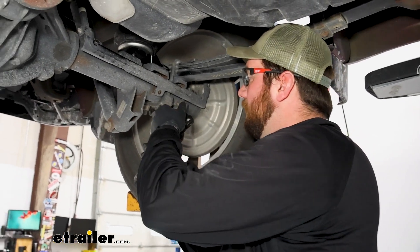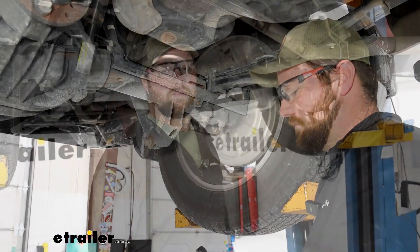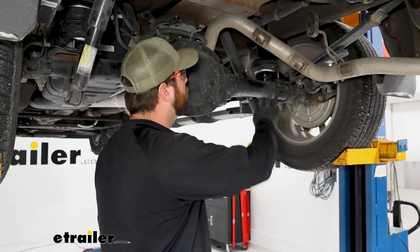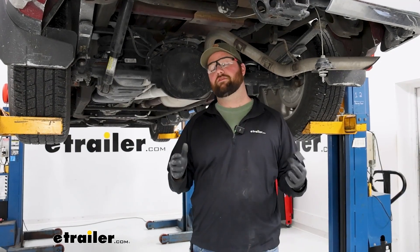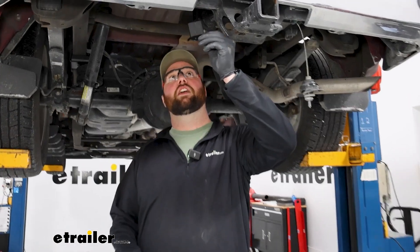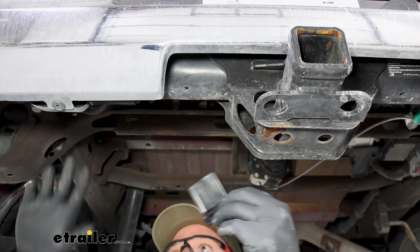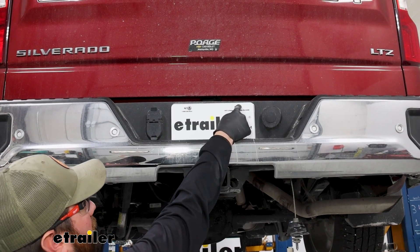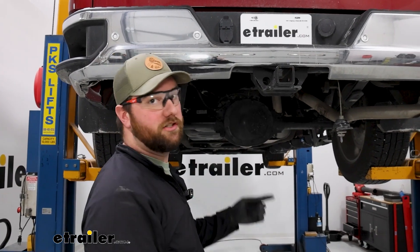Once the airbag is installed, put the bracket back up into place. Once you've got one side done, repeat the same process on the passenger side — just remember to put the heat shield up before putting the bag into the top bracket. The last thing for the kit installation is to run your airlines and connect them to the bracket that comes in the kit. You can mount it around your hitch, or alternatively, drill out the top two holes of your license plate and use the bottom two holes for the screws.